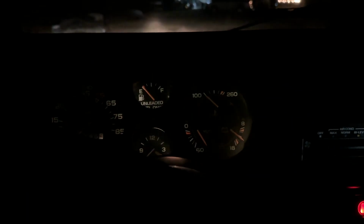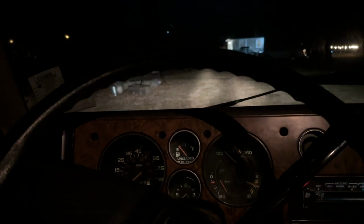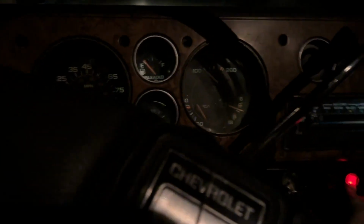Really? The good news is we have hot oil pressure at 42 PSI at idle, so that's good. So it's not all bad news. Engine seems healthy, just idling nice. Unless we're missing something, transmission is shot. Still nothing. No signs of improvement. We've got really good reverse, but that's about it.